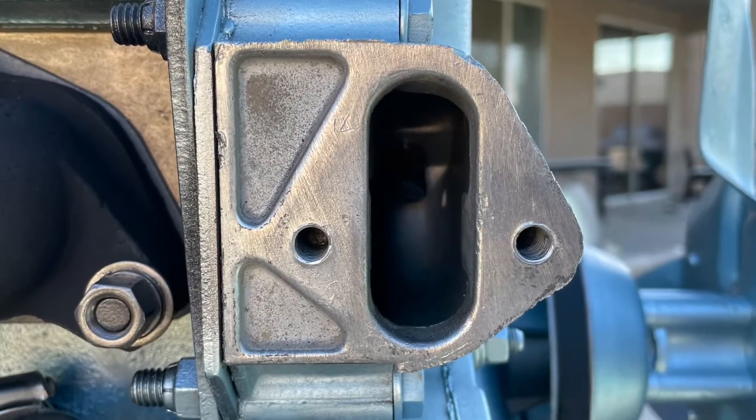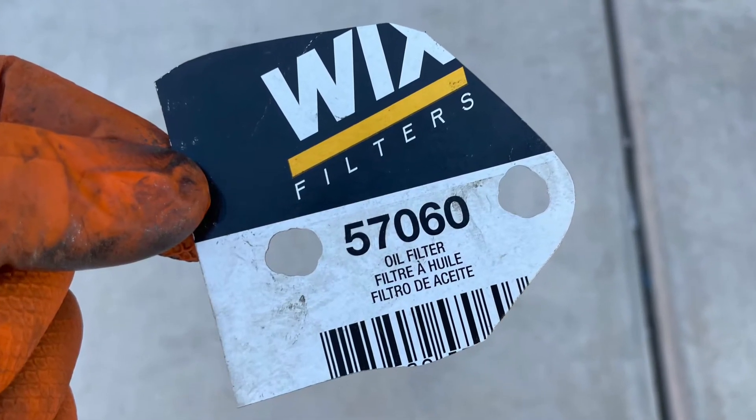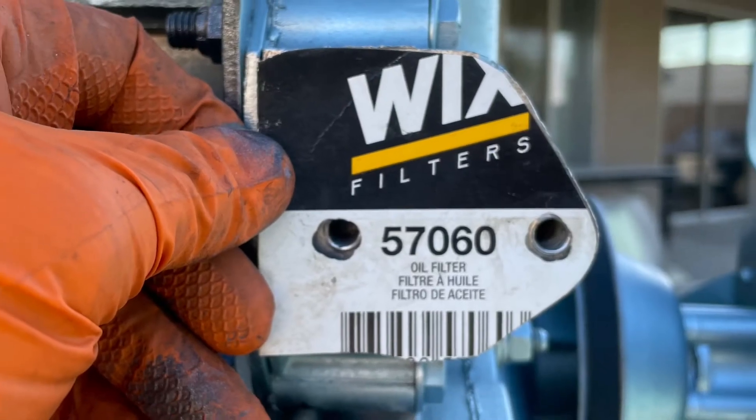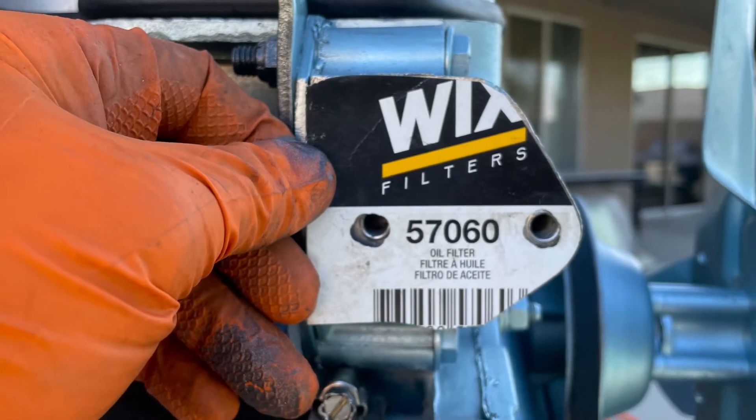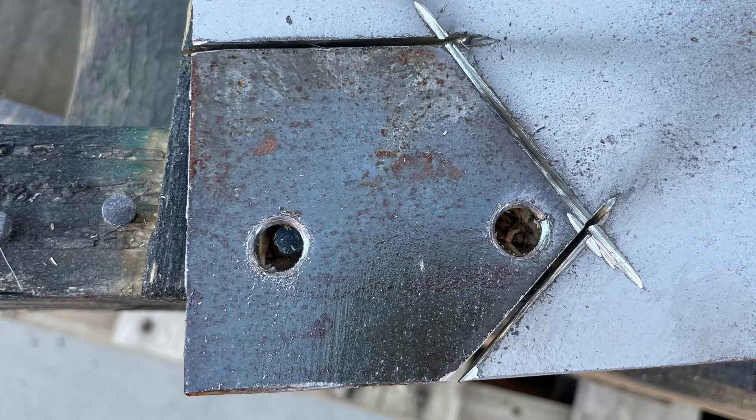This is the location of the fuel pump. The first thing I do is cut a paper to match, then I check it against the location of the deleted part. If it's good enough, I then clamp it to a sheet of steel and spray it over for my cutting template. Then I drill the holes and make the cuts. A flap disc makes it look pretty.